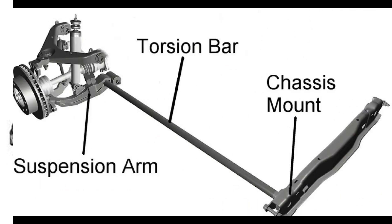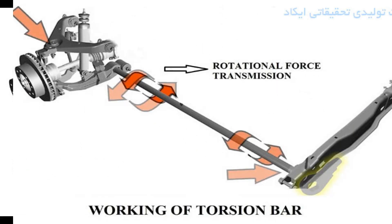Today we are interested in torsion suspension — its pros and cons. The principle of such a suspension was applied in the 1930s and for the first time realized in the chassis of the Citroen car. After some time, this design interested German automakers, and its principle was used in the running gear of the Volkswagen Beetle. Torsions were also used in the suspension of the heavy Soviet tank KV and German Panther. Among domestic cars, torsion bar suspension was used in the legendary Zaporozhets, ZIL truck, and the all-wheel-drive small car LUAZ, nicknamed by car enthusiasts the Moonwalker.